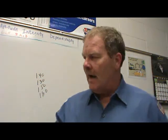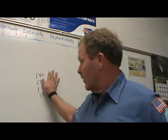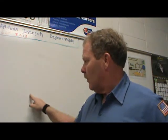When performing a power balance test, cylinders that drop 50 RPM or less than the other cylinders should be analyzed. The IDS Ford diagnostic tool has a really cool way to check that — a little track on the screen. When you're dropping a cylinder you'll see a little V where the RPM dropped.